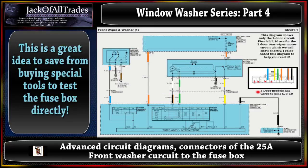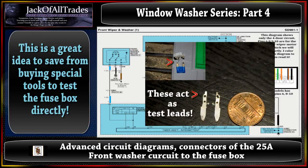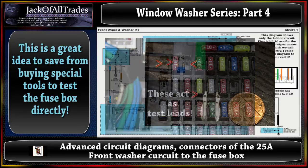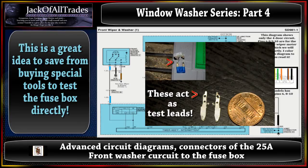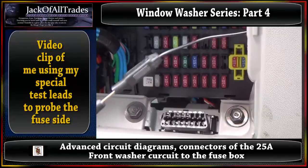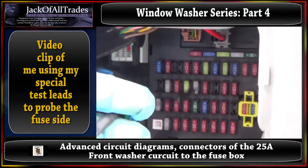Let's go back to the car and run a test. I'm going to show you something else quickly - here is a diagram of a fuse I took apart with a razor blade and I took the test leads out. What you're going to want to do if you don't have micro test leads is take an old fuse, break it apart, and insert the tips into the fuse panel. That way you don't spread the female contacts - if you start jamming things into the fuse box you might not have a good contact the next time you insert the fuse. Just take apart a fuse and use the tips to allow the probe into the fuse box.